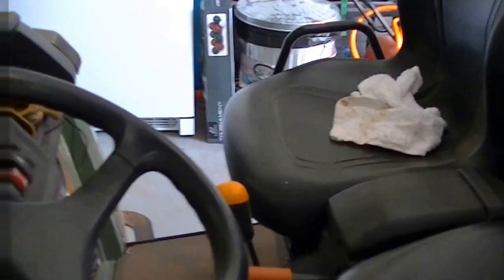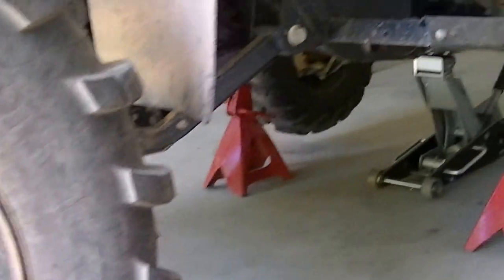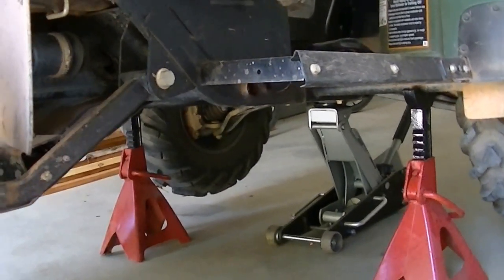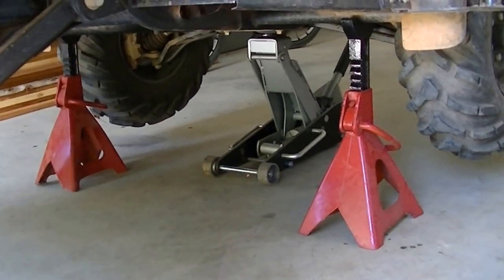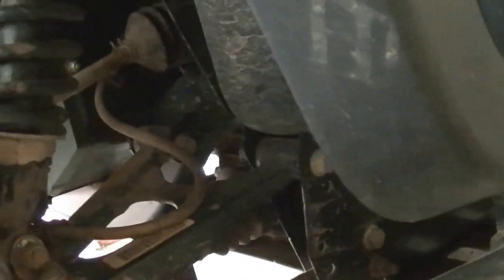So now our Gator is up on the ramps. I'll have it in neutral with the brakes set, and we'll get under here with the creeper and get started. Before we got started, I went ahead and placed a jack underneath the front to raise up and level the Gator a little more, just so I could get more room underneath to access everything for the oil change. I have a couple jack stands here for safety. As you raise this thing up, you want to do a little visual inspection of your suspension — which is dirty — and make sure your wheel bearings are functioning right, they're not loose. Everything seems to be nice and tight underneath our Gator.